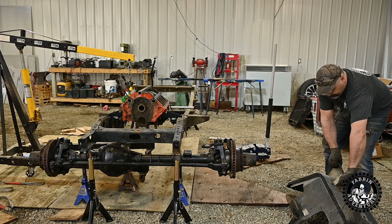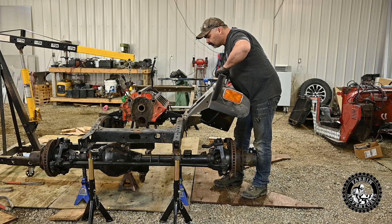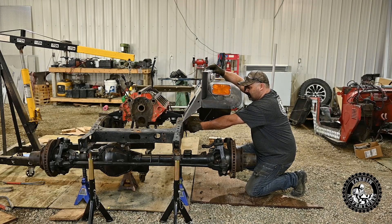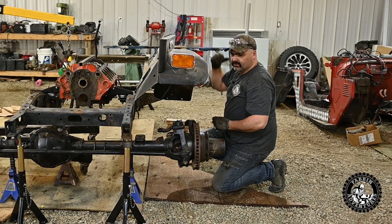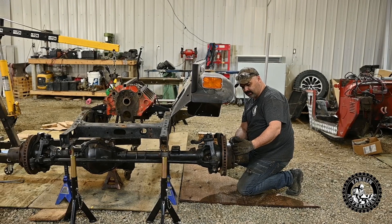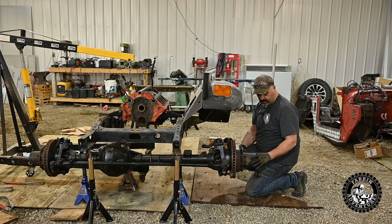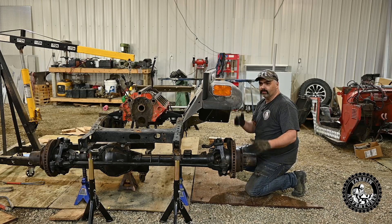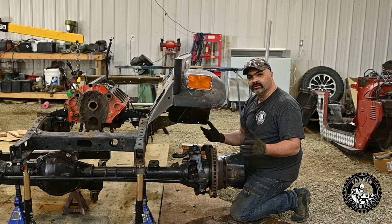The handy thing with this FJ build is we can just drop the fenders on and find the right slot to see how far out they stick — just like that. Not too bad. I've got some wheels coming that are zero offset — on by nine — so we're going to have some wheels stick out for sure. We may end up having to make new fender flares or put some rubber flares on to cover that wheel stick-out so the cops aren't on our tail when this build hits the road.